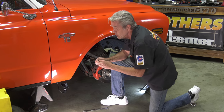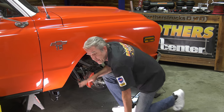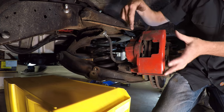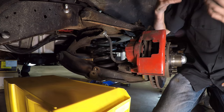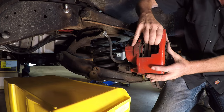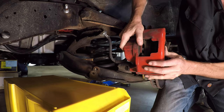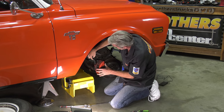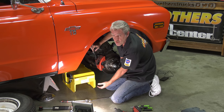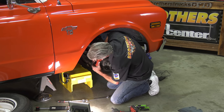When your nuts and bolts come off, go ahead and get them together and bolt them back up so it's easier to find everything when it goes back together. For the caliper, I could unbolt it, but then I'd have to bleed the brakes afterward. To save time, I'll simply set the caliper on a nearby box. The main thing is we don't want any tension on the rubber hose — if you let it hang and drag it'll likely crack, so keep that hose protected.